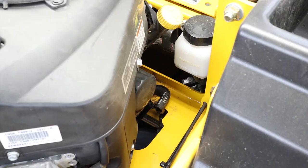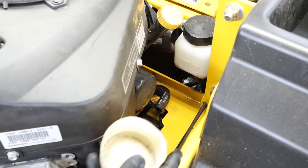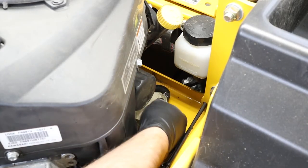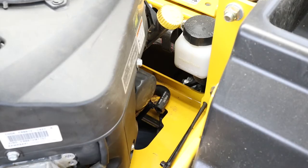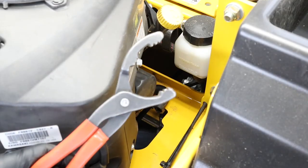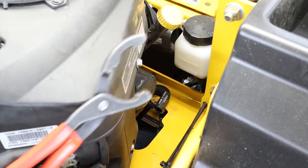On these Kawasaki engines, if you don't have an opening in your engine plate below the oil filter like we do, you can use the bottom of a cup — just cut down short enough to fit underneath that filter to catch the oil that's going to run off the bottom of it so it doesn't make a mess. To remove these filters, I just use a pair of oil filter pliers — I'll leave a link in the description below.